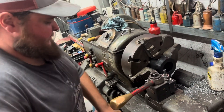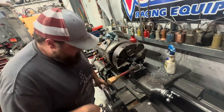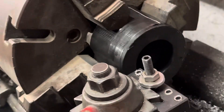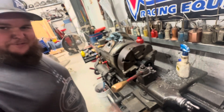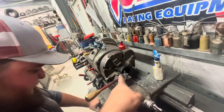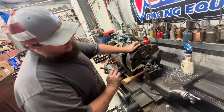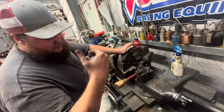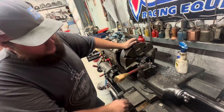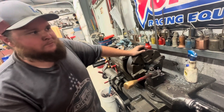No more test runs — this is the first cutting of an actual piston we're going to be using. This piston will end up in the motor, one way or another. Even if there's a massive gouge in it. So we're going to shave 50 thou off the top of it, take 180 thou out of the lip, 50 thou off the top, and then do a 50 thou chamfer on the edge. Clean it up with some Scotch-Brite and a little bit of super-fine sandpaper, and she'll be good to go in the motor. We'll see if it makes power or if it just blows up on the stand.